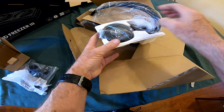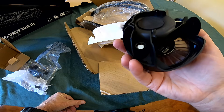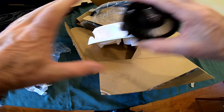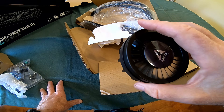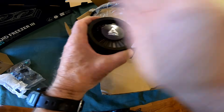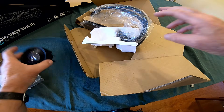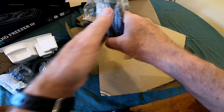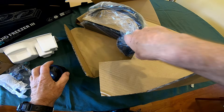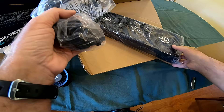One attractive thing for me is this VRM fan that goes down onto the motherboard — that seems like a pretty obvious and smart design, because it helps increase air circulation over the power regulation components on the board. Normally air flows horizontally, but now we have air going down and across all the power-regulating components. This fan comes off held by magnets, so you install the cold plate on your CPU and then attach this on top. It's got little connectors that connect power and controls via a corresponding connection on the cold block.